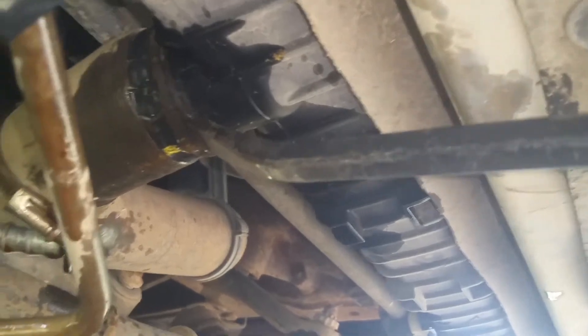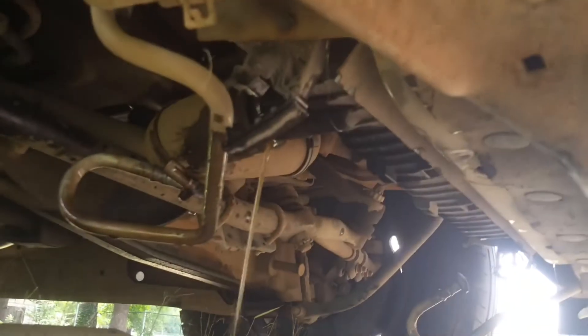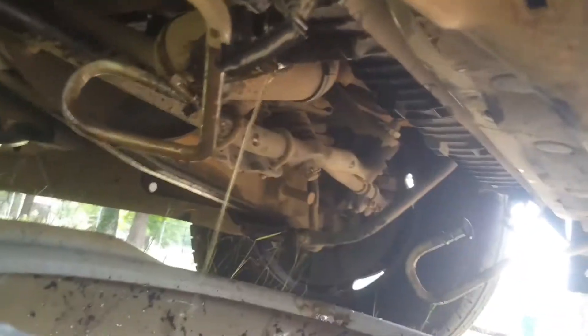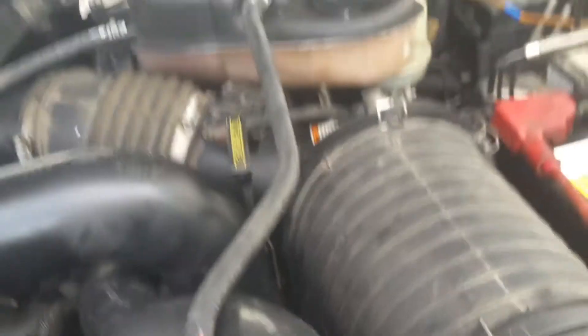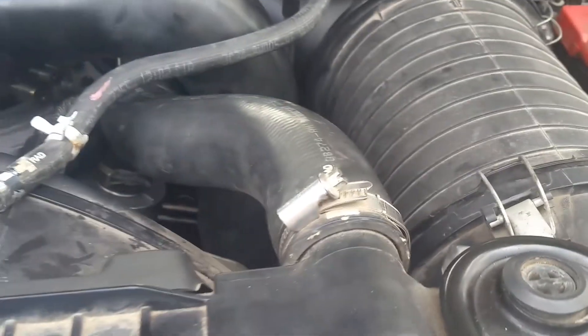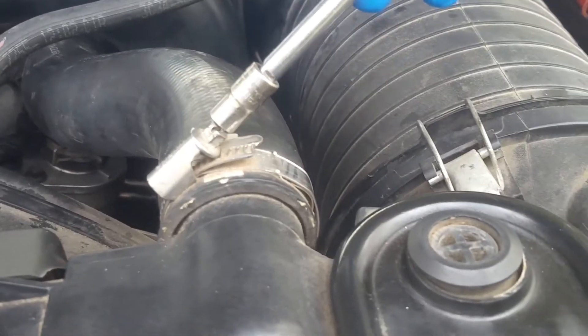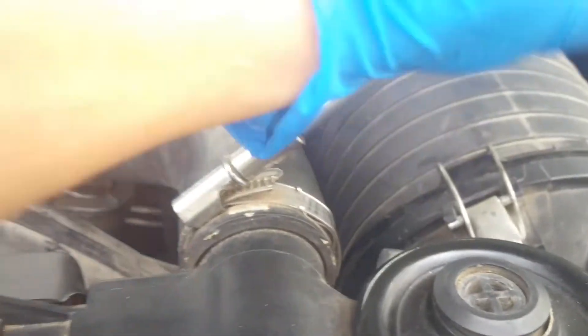Because these hoses like to really get stuck, I like to use a screwdriver to push and get some leverage. Sometimes I'll even apply a little bit of WD-40 under there, just depending on how bad it gets stuck. So we're just going to go ahead and push that off of there. Make sure to have your pan ready because it will have some coolant up in that hose too. Now that we're up top, we're going to have a little hose going to a little nub here. Just take some pliers, get that loose, and push that back. Then go ahead and take our 7mm and get this one right here loose, and push it off just like we did that other one.